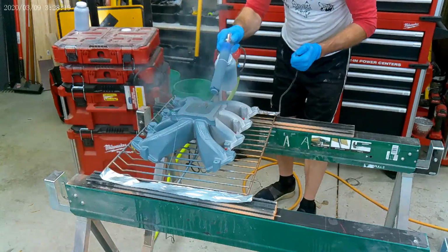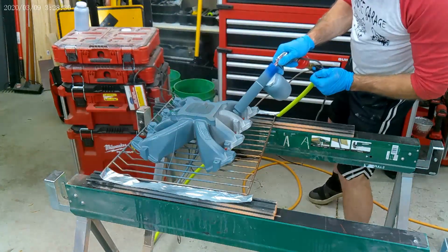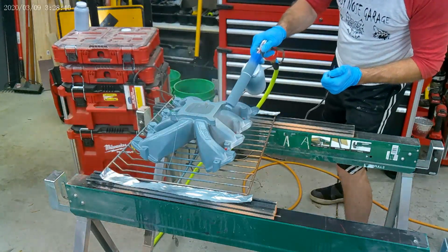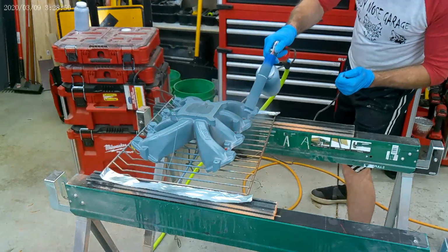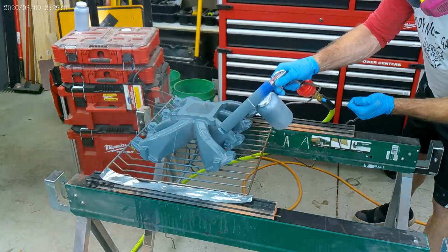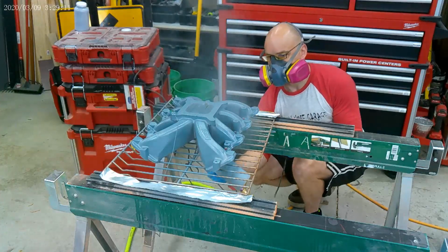And the instructions on this zinc rich primer were a little different than the other powders. It's 375 for only 3 minutes, and then they want you to recoat immediately with your, I'm going to call it the base coat, which is going to be my chrome today. You can see it's already kind of flowing. It's getting a sheen to it, and it's going on really nice.